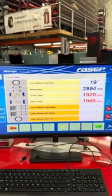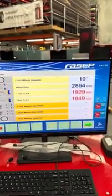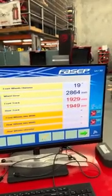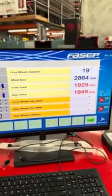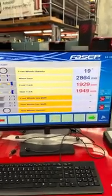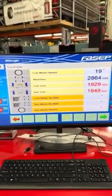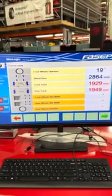Now, because we're using the ATM and we're scanning the outside profile of each tire itself, it's correctly identified there's a 20mm difference in track, but it's put the rear track as the 20mm. So we'll still get a good alignment on this vehicle without putting in any of the rim width or rear diameter at all. It's very quick, very easy to use, and you'd now continue alignment. When you finish, go back to that ATM page and you're ready for the next vehicle.